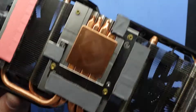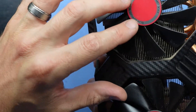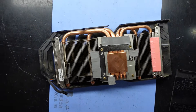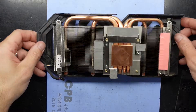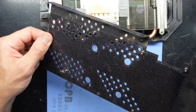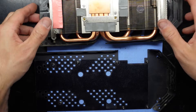The thermal pads on this one look and feel very oily, which is what you want, so I'm not going to disturb them. Around here they do look fairly dusty and not great, so I'll hit that with the air compressor as well and then we'll reassemble. I didn't really change too much but let's go ahead and get this back together — actually I'll give this a quick brush on the inside.